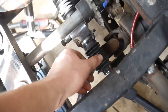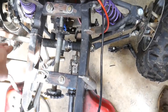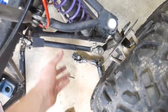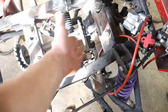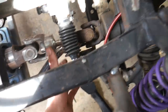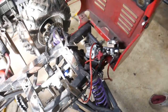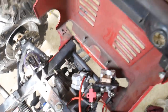I got this rack and pinion mounted. This jack shaft being here is making it really hard to mount, but I think we got it figured out for the most part. Ideally you want your steering arms to be pretty much like this — this is pretty much what I was able to come up with. I can't scoot this rack any further forward; otherwise it will interfere with the sprocket or the drive shaft right there. Despite that, I think this should be a lot better than the previous steering setup, just because the whole diff was in the way.